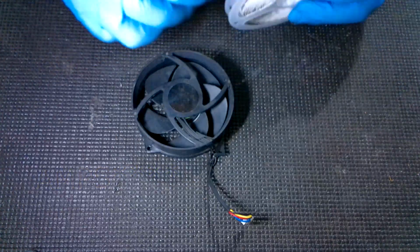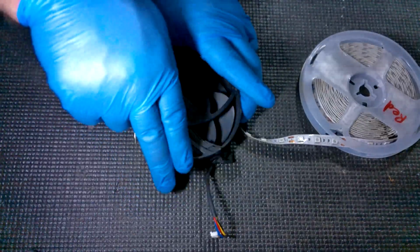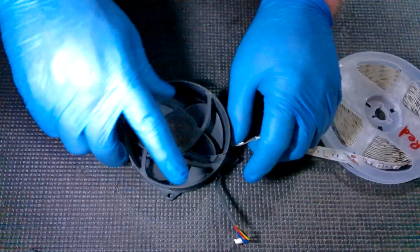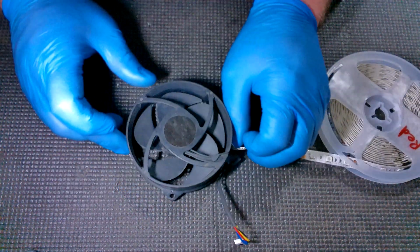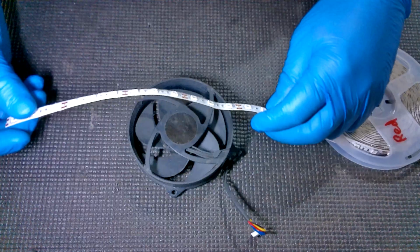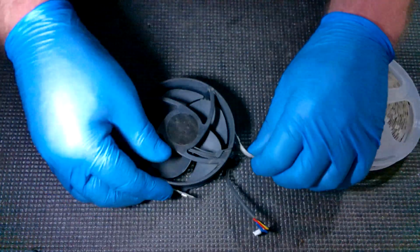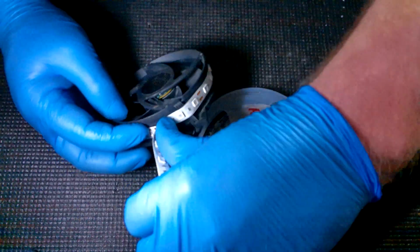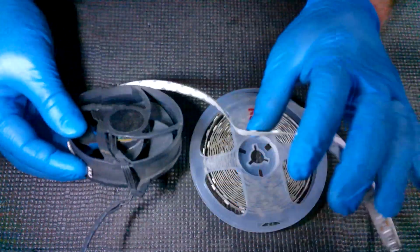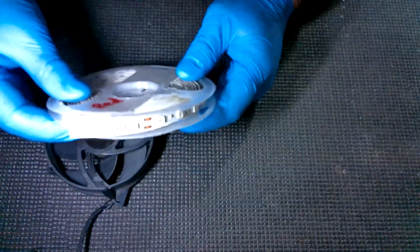That also means that with those types of LEDs, you're only going to be attaching them like this. So as you can imagine, this backside is not going to have as many LEDs. In fact, it's going to be probably more like this, so it covers about two-thirds. There are going to be some areas where the light is not as bright, and I think it is noticeable, and it's something you should be aware of. With these right here, the benefit to what I use is that they're a little bit lower ohms, meaning I can put more LEDs on them. So while a general limitation means I can't put it all the way, it is still going to be more like this on these, and you don't have much of a gap. That's just the way it is because I get commercial grade and I can get different specs on these. The LEDs themselves, we'll go ahead and go over the stats.